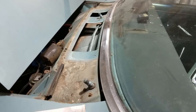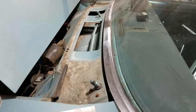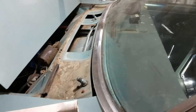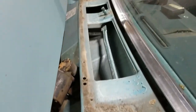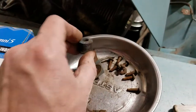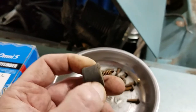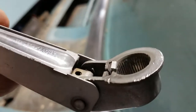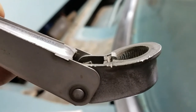Let's have a discussion about the cowl — this is going to be a problem on all Mustangs, Fairlanes, Falcons, pretty much any unibody Ford in the 1960s. It's just a bad design; these cars were not designed to last more than 10 years, that was their expected service life. This is with the cowl vent piece removed — it's just a bunch of screws across the front. Make sure if you have one of these rubber bumpers it has a screw in the center, it's going to be filled with gunk, so blow that out before you try to remove it. Then you have to remove the wipers — there's a tab on the end that has to be pushed away from the pivot.